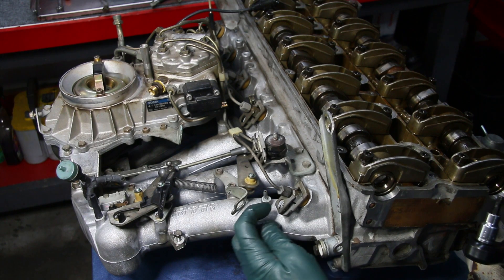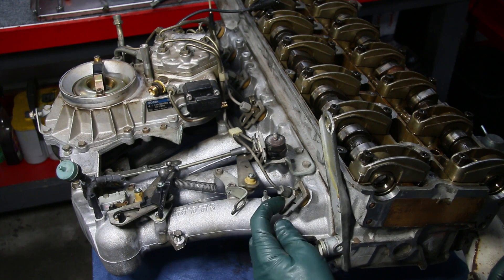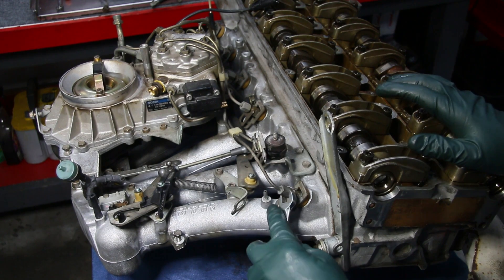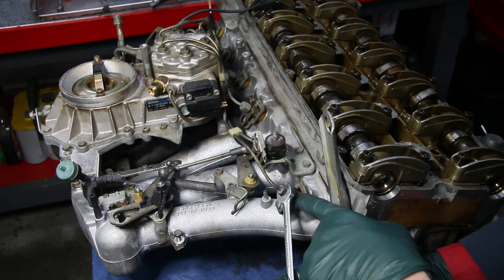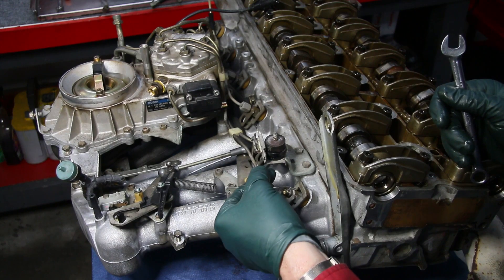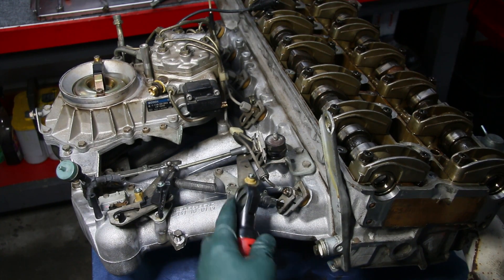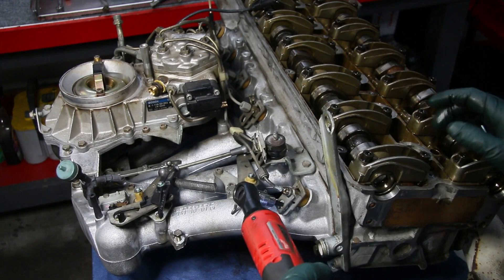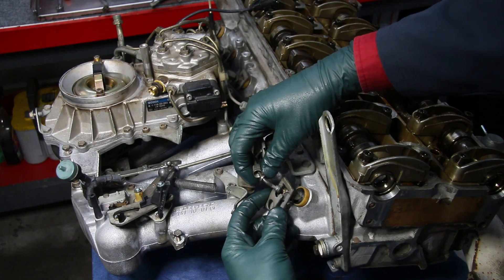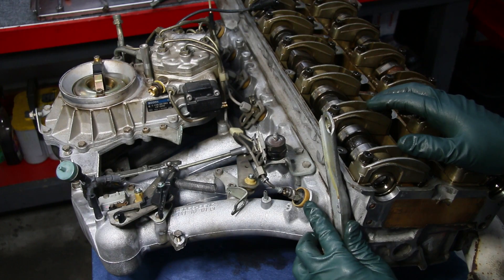For this video I'm only going to remove one fuel injector. The hold-down bracket is held in place with a five-millimeter hex bolt, but before you remove that, you want to loosen and remove the line first. This fitting is 12 millimeter — it will move a little because the injector moves in the stamped holder, but just snap it to loosen it and back the fitting out, lightly bending it out of the way. Then take the hex socket, break that bolt loose, spin it out, and the hold-down bracket comes right off the top of the injector.